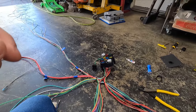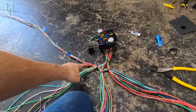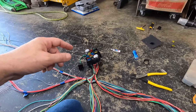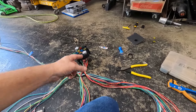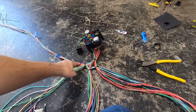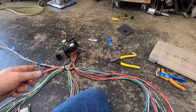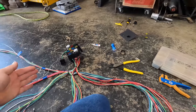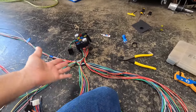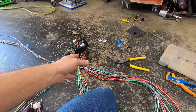Interestingly enough, the AC compressor wire that comes in this kit — it says 'AC compressor' on it — was just basically zip-tied through. It doesn't go to that fuse box at all. It came out with the dash stuff. I'm pretty sure that the Vintage Air kit, when you get that kit, that wire goes on the passenger side. So I just pulled it through because it wasn't connected to anything — neither end was connected. I rolled it up and put it in my wiring box. If he buys a Vintage Air kit it'll come with that wire anyway, so it was unnecessary.